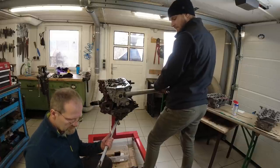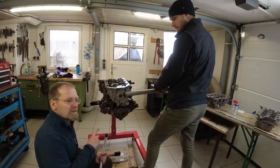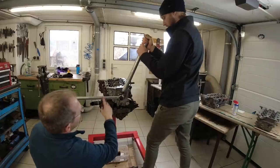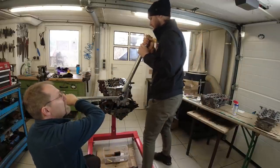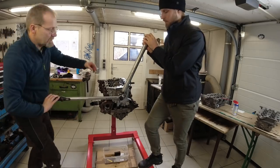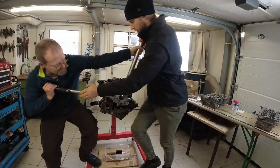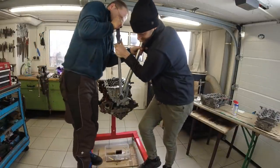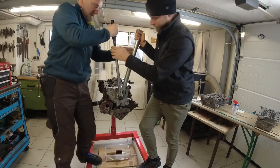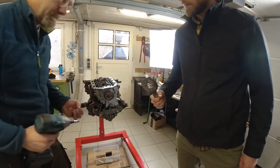So I got the torque wrench set to 380. If it clicks before I have 90 degrees, I stop. When this wrench is straight up, and when I come around, you grab the wrench and you help pulling, and I grab your handle and you can keep pulling, yeah? And we gotta stop when it clicks, 90 degrees. Pull, pull, pull. Good. Perfect. So, very well.